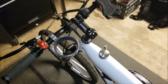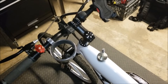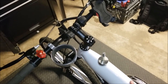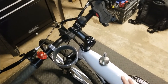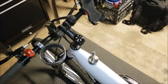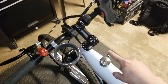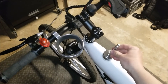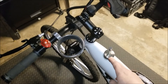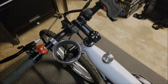Next I want to show you the gas cap — you can see it's got one of these little vent tubes on there. A lot of other people put them on, but for me it was a necessity, not just for looks. When I first got the bike, a vacuum would be created, and anytime a little bit of air found its way through the cap, the carburetor would flood and there'd be fuel all over the place — a safety hazard. So I put one of these on so there is airflow that goes all the way through the cap and into the tank.